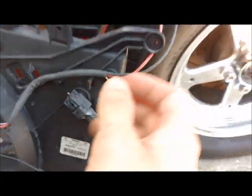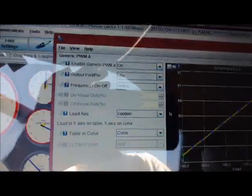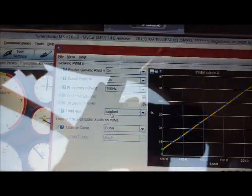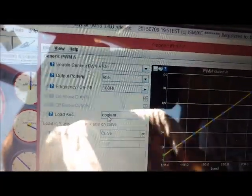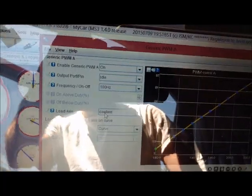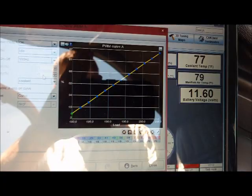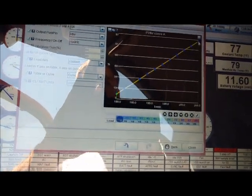When I checked it with the meter, even with everything off it has 12 volts to it, so it's got battery voltage going to it all the time. In the MegaSquirt software I've got it labeled 'Generic PWMA,' then under output pin you turn on the idle pin. The frequency is 100 Hz, which is working so far. I'm using coolant temperature to drive the speed — right now I've got it starting at 180 degrees, coming on at about 10 percent duty cycle, then going up to 205 degrees at 95 percent duty, which is basically full blast.